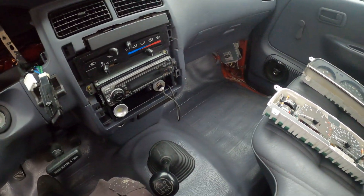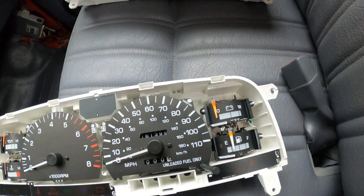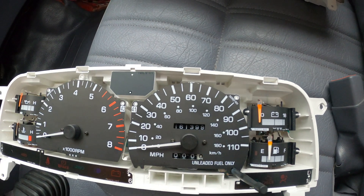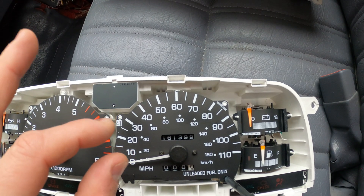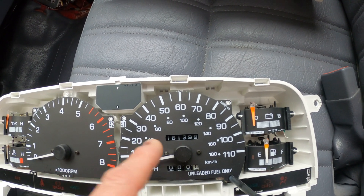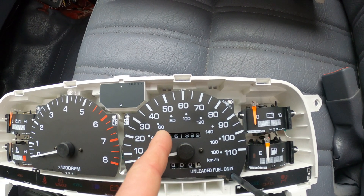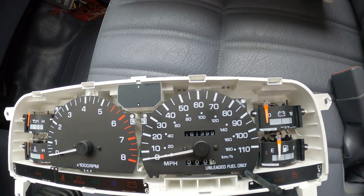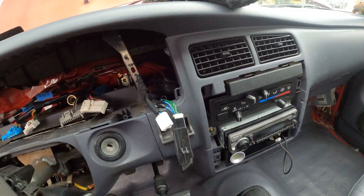As for the speedo, you can also modify the numbers in the gauge cluster. Remove three bolts from the back of the speedo. There's a small bar that goes across the back of the odometer — it's held in by pressure and a slight clamp. Loosen the clamp and tack the bar to the left or right. With the bar out, slip a screwdriver in the back of the odometer between the two numbers you want to modify, then use another screwdriver to carefully rotate the desired wheel to the desired number. Put the bar back and tighten it.